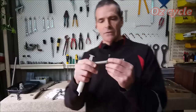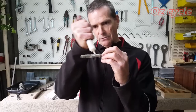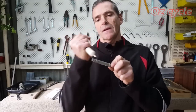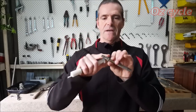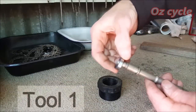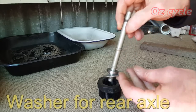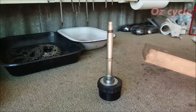To put everything back together, do everything in reverse approximately. Put the axle in the hub — that's the drive side, the non-drive side, and where it sits on the bearings. Just a little smear of grease on there. It goes through the spacer washer, and put a little bit on that side as well because you're going to put the bearing on it in a second. Here's the large bush again. Slip your bearing on the axle — if it's a polarized bearing make sure you get it around the right way. Use your washer, piece of wood, and tap it on.